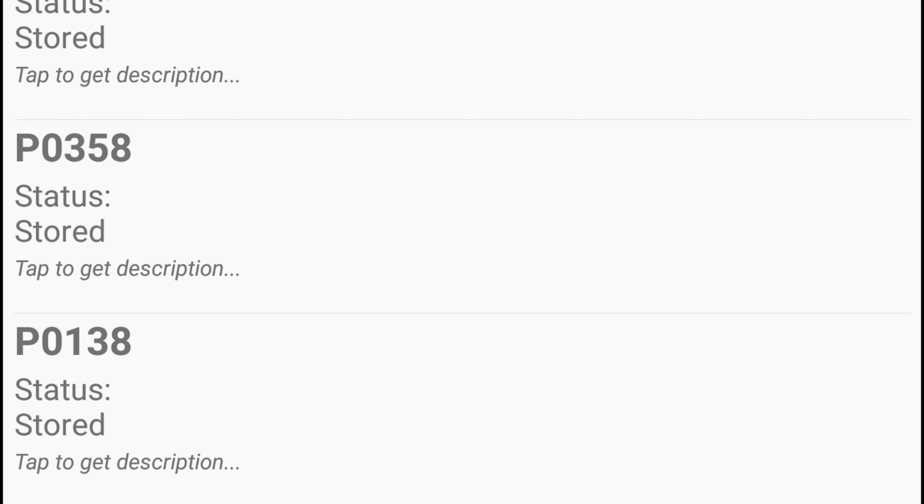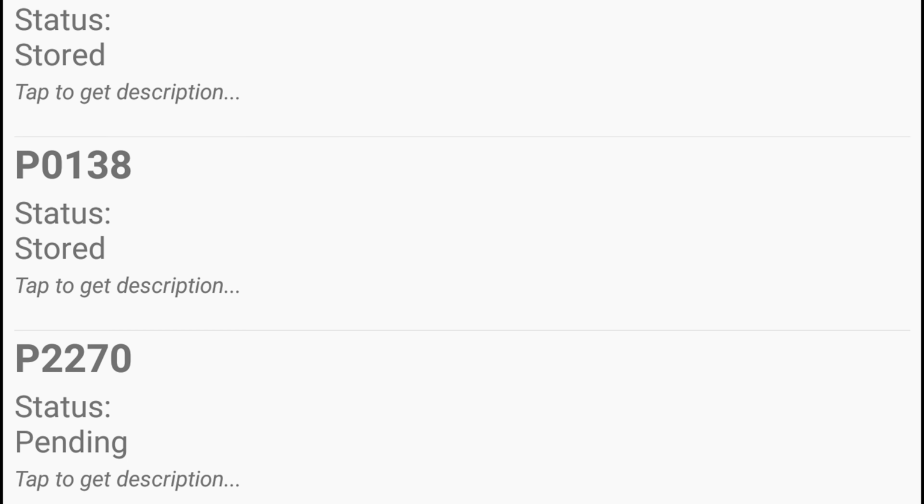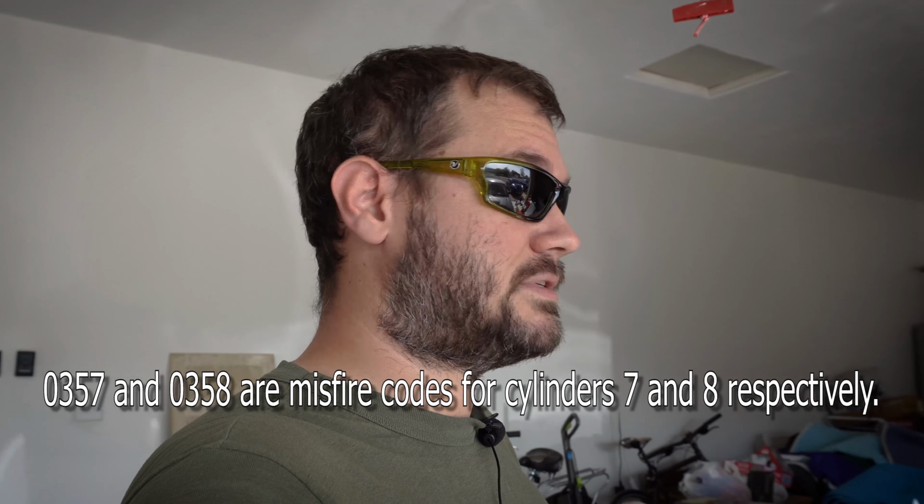To fix that, I had an idea of what it was. I thought it was probably still misfiring, and probably because of the coil packs. Pretty common thing with these cars. Ran the codes, and yep, misfire on 2 cylinders. So I was expecting to spend 50 bucks or so on new coil packs for this thing. So for 2 of them, 100 bucks, just say.